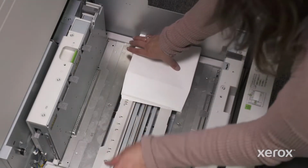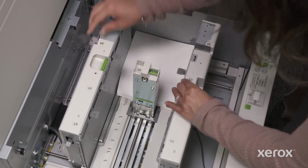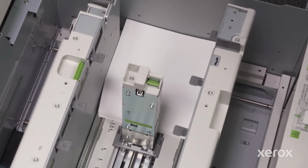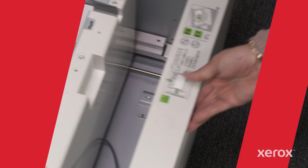As long as the two long side paper guides and the short edge paper guide come in contact with the envelope edge, you are good to go. You can also print envelopes with the flap open, with either kit or no kit at all. When printing with flaps open, be sure to orient the envelope in the feeder with the flap edge trailing.